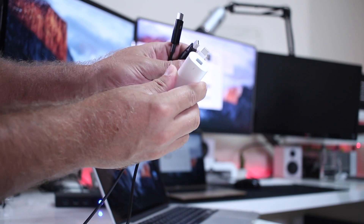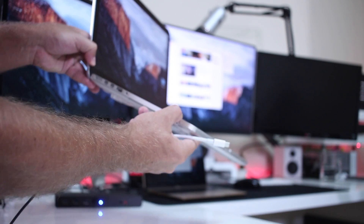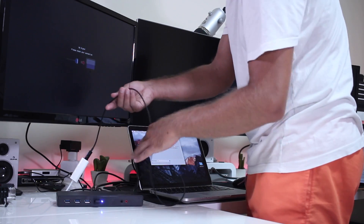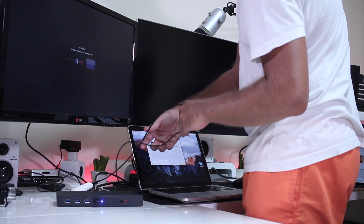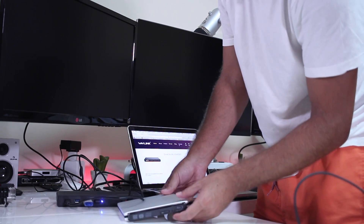I also tested with my MacBook Pro early 2015 and with a Thunderbolt 2 to Thunderbolt 3 adapter it did not work, which means it works over USB rather than Thunderbolt. Of course, if you have one of the newest MacBook Pro 13-inch or 15-inch with Thunderbolt 3, you'll be fine, but for older MacBook Pros it will work only over USB 3.0.